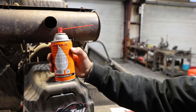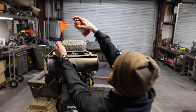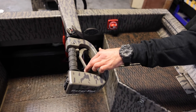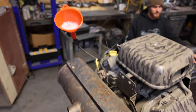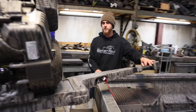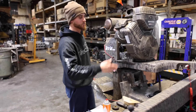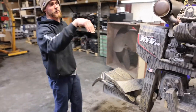You can use any kind of WD-40 lubricant, just something to get inside and push the moisture out of the cable. Go ahead and fill it up on top of the cable and then work the throttle back and forth. It's going to take some time for the lube to actually get down in the cable and to the end of the tiller. But once you see it start dripping out of the end of the cable, it should be pretty lubed. If the transom angle of your boat isn't quite right, you want the handle a little further down — just lift it and chock it up so the fluid goes down into the cable.